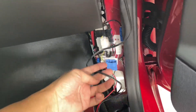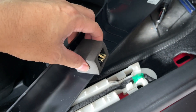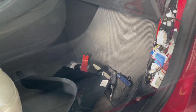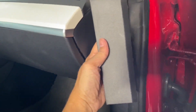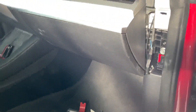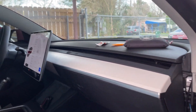Come down through here — it's pretty much the perfect length. It goes down, tuck it back here near the fuse, and there's a foam piece it goes through, then into this hole. It's easier if you remove the weather seal and pull this piece up — it'll come out so you can put the wire in, then put the weather seal back. The final piece goes down here and anchors behind the weather seal. Remove this piece first, test the power, then work backward. Bundle any extra wire down here rather than hiding it all in the headliner, though I did leave good slack just in case.